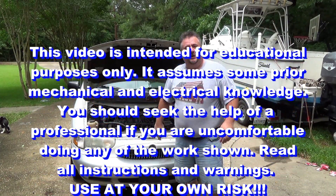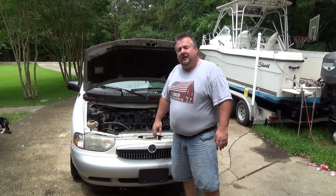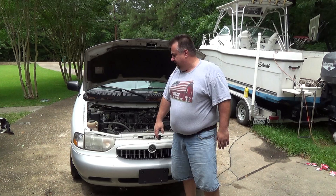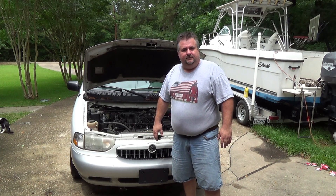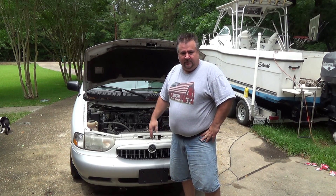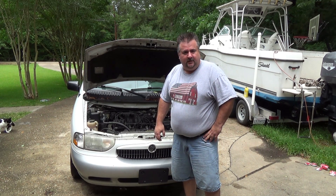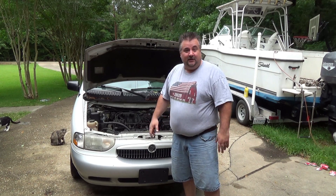Hello. In today's video we're going to see how to replace a distributor. This is a 2000 Nissan Quest slash Mercury Villager. It has a little rough idle but when it runs at higher speeds everything's fine — up until recently, now we're getting some more signals and codes. There's a knock sensor code, which is pretty common for this vehicle, and also some cylinder mis-codes. We've troubleshot some of it, but if you've confirmed it's the distributor, today you're going to see how to change it very quickly and easily.